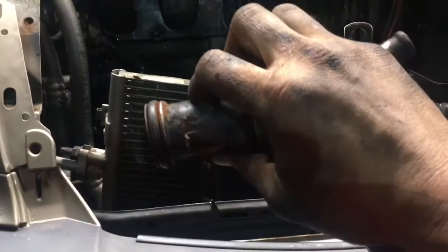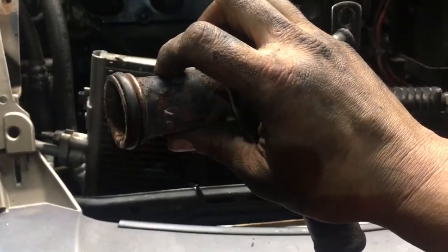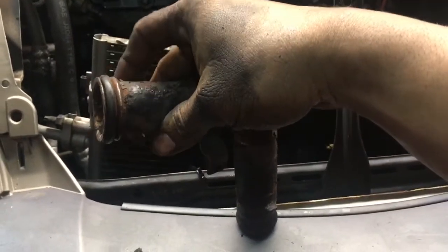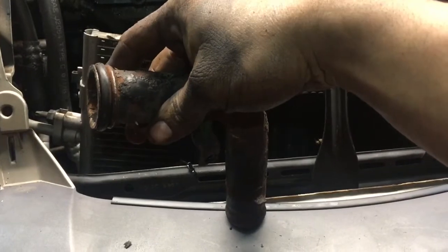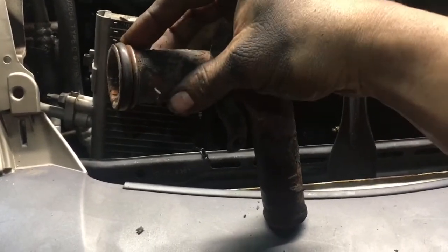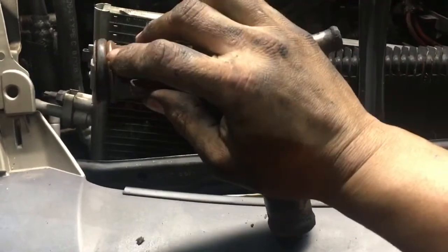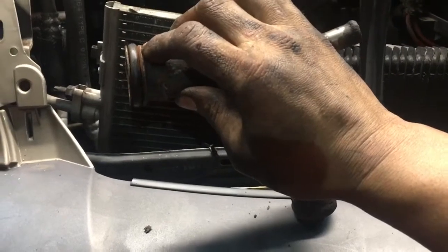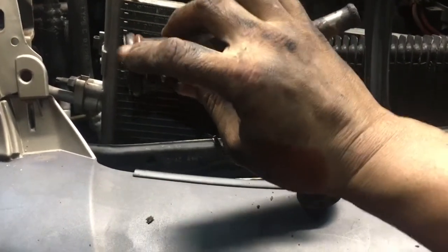When I got it up in there, I tried to start it pitched towards the back. The reason I did that is because I can't see the gasket in the back once it's against the water pump housing. So I wanted to make sure that the o-ring portion was started first, and then you just take a little screwdriver — or in my situation I could use my fingers — and push this gasket back in.